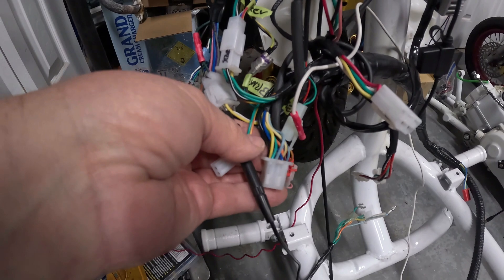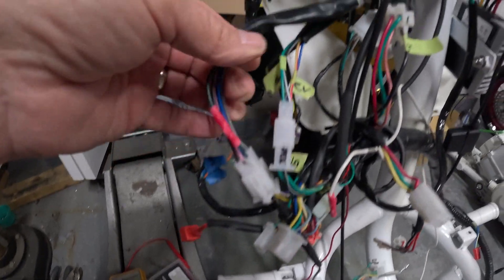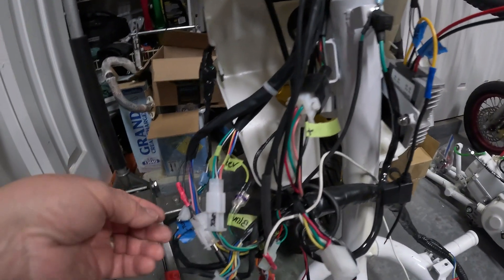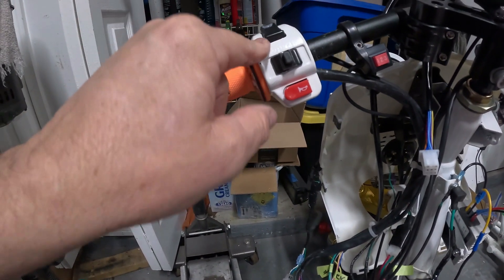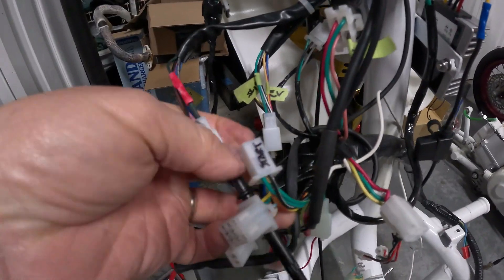These wires aren't going anywhere — this wire was going to the rectifier so it's disconnected, this wire was going to the stator it's disconnected — and we're going to turn our feeds to the headlight and tail light into 12-volt DC power. I don't like to make cuts into the main harness, so I'll make it on the switch side. I'm going to use this switch side because I can replace these switches pretty cheap. This is a switch wire coming down from the horn, the blinkers, and the headlights, so we know it has AC power and DC power going into this switch.